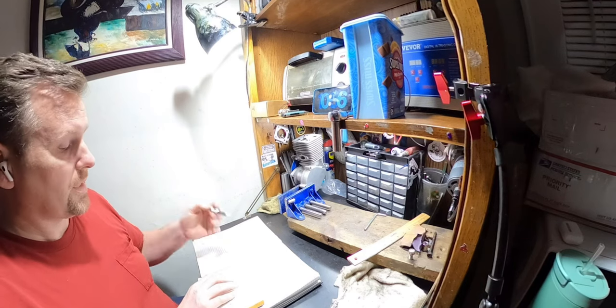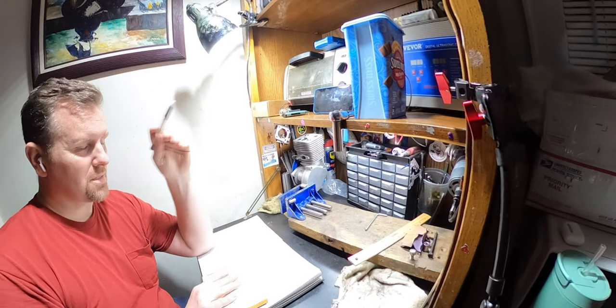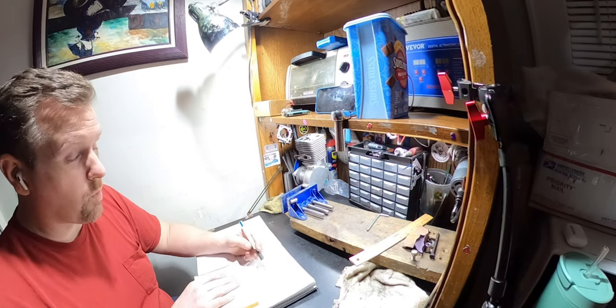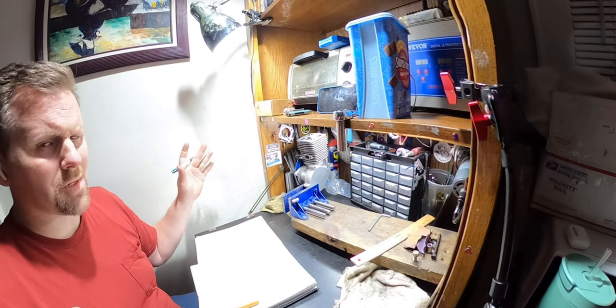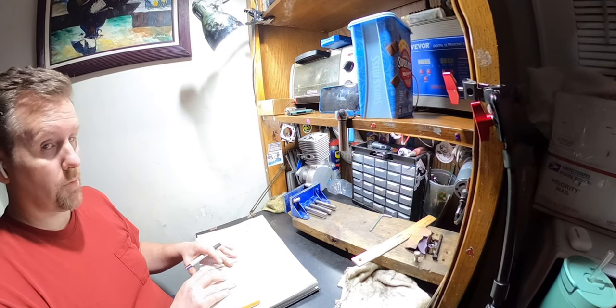That's crazy. This one, I couldn't even get it to squish my solder. And I use extremely thick solder to measure with. It was 1.78, the squish on this one. No base gasket. Needless to say, we will 100% be deleting that. Oh man, I'm blown away by that.